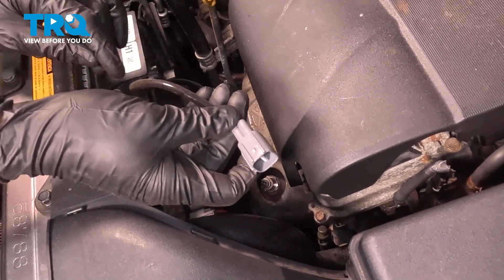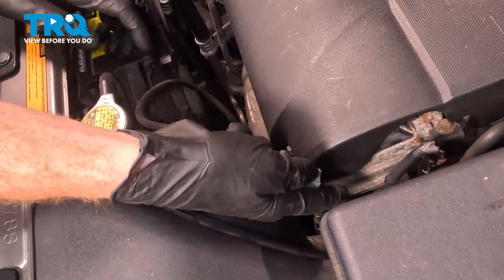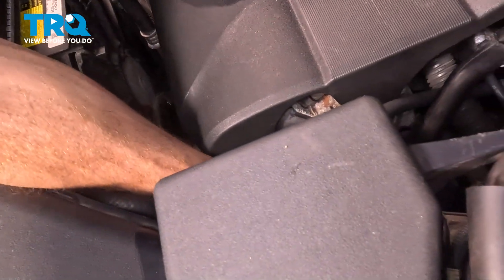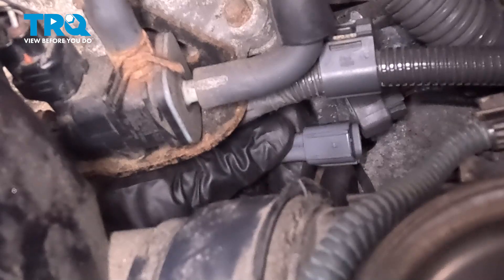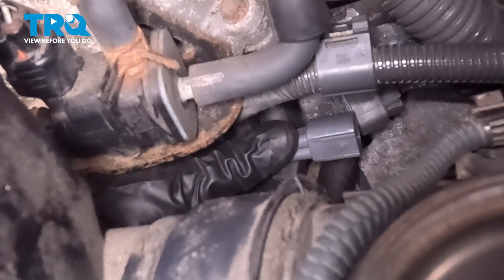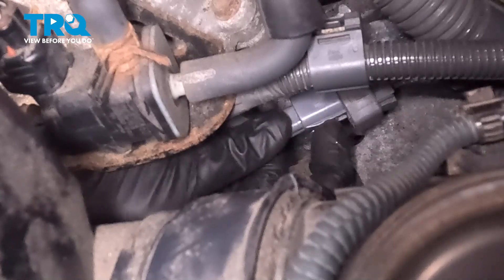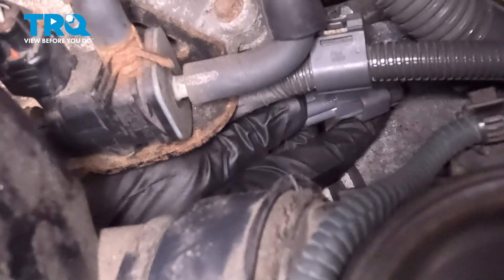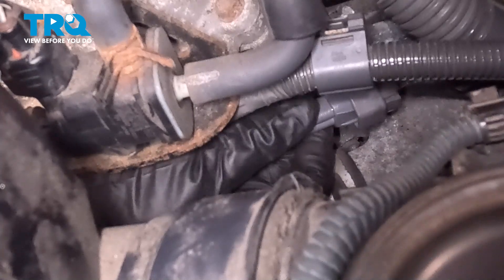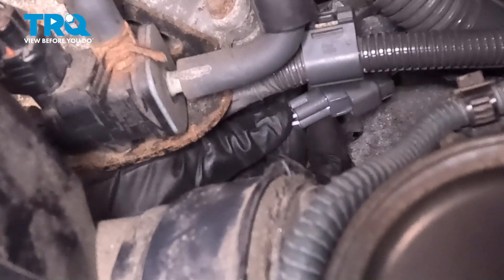Now it's time for the electrical connector. We're going to take this entire wiring harness and bring it right back through the same position as where we had removed it, along the top of the radiator hose. Looking in here, I can see the other portion of that connector. We're going to align the locking tab. The locking tab on the O2 sensor wiring harness connector faces towards the driver's side of the vehicle. Press it in and listen for a click. Once you do hear that click, give it a little tug to make sure it's secured. If this isn't properly secured, you're going to have a check engine light.